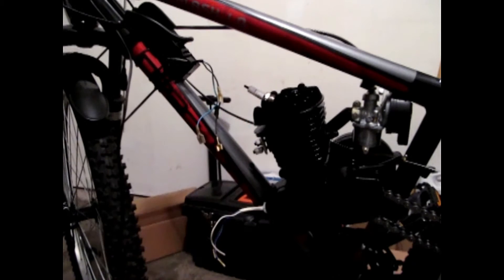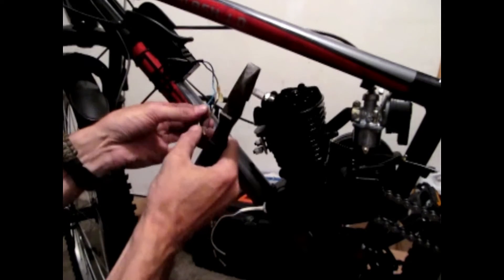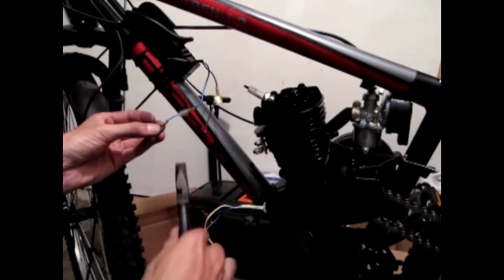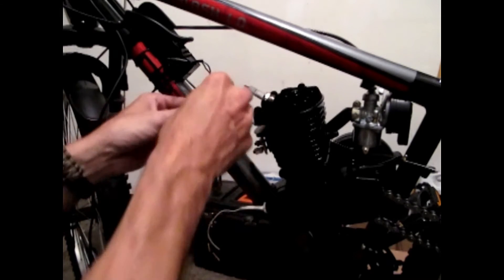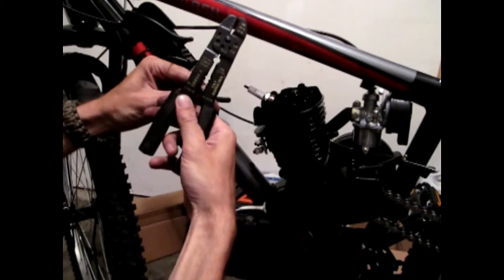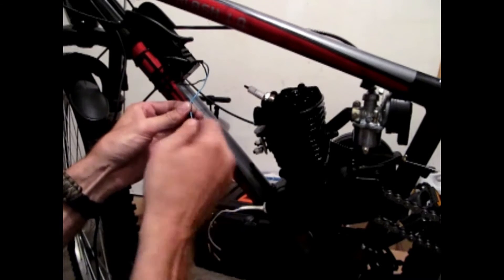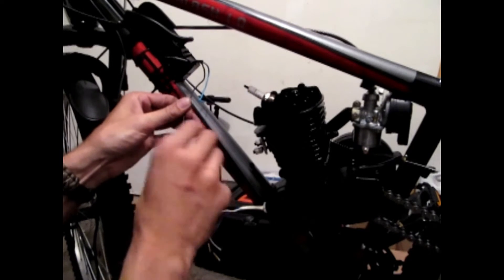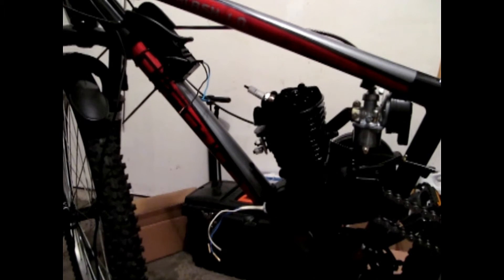Now I remove this boot up here, I'm going to come in and trim these wires off. People say you plug these in, but look — it ain't gonna work. It just doesn't, so might as well do it right the first time so you don't have to repeat the process. Take off those clamps. One thing about these coils — they're kind of cheap, in fact they're real cheap, so sometimes they do bust. I'm forewarning you. Spark plugs aren't bad, but you can't go to the store and get a regular spark plug — you have to go back on eBay.